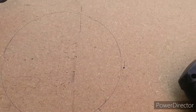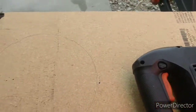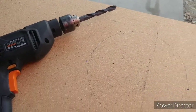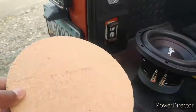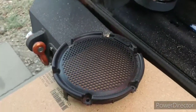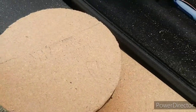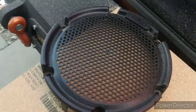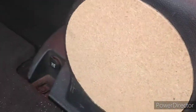I'm using my little jigsaw here — this will cut my circle. There we go, that's my perfectly round piece right there, cut with the jigsaw. It almost fits — maybe an eighth of an inch bigger. If you just trace the old frame that goes around the stock speaker, it'll work. You can probably cut it almost exact. There it is sitting inside of there — it's flush all the way around the edges, so when I drill my holes this is going to come out perfect.